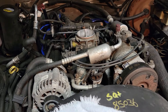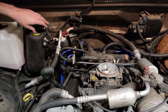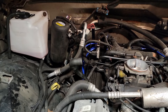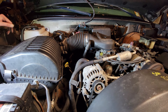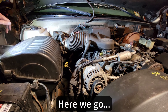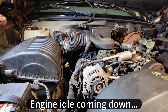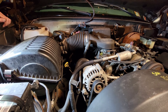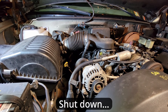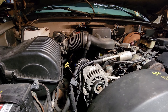We could start it now just to make sure it works — but wait, it needs the mass airflow sensor. We put the mass airflow sensors and air box back in. Everything's in place. We took bets on whether it starts — and it started right up. It's nice and smooth. The belt is a little squeaky, but it started right up and the throttle feels really smooth.